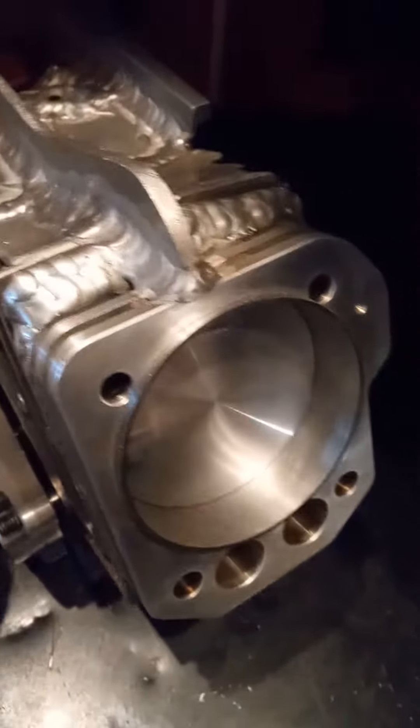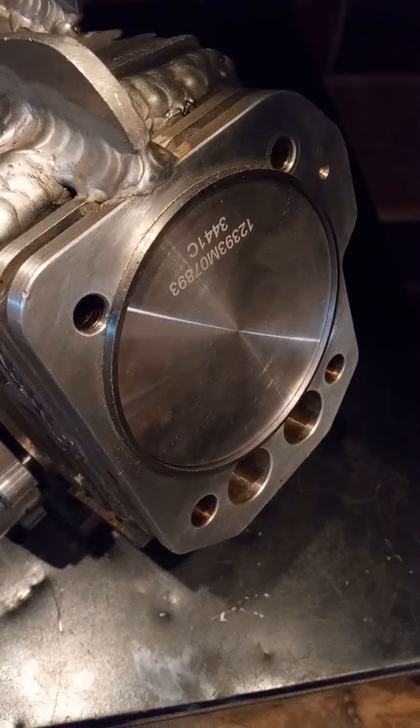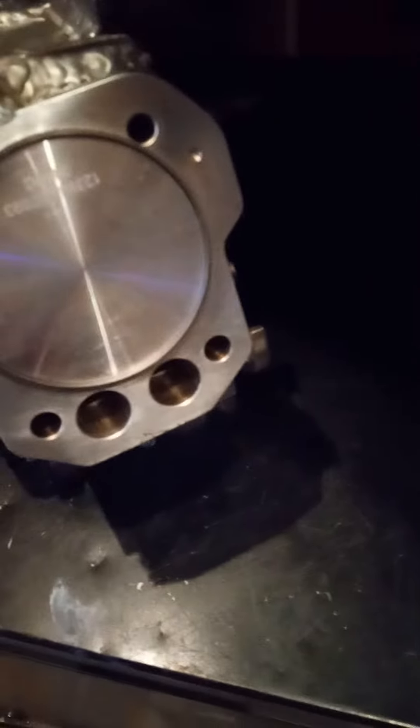All the pieces are cleared now. I got a rotating assembly! Everything cleared up, just got to get the piston cut. A few thousandths — see how close it is to the top. Maybe about 20, 30 thousandths got to be cut, be evened up with the deck.